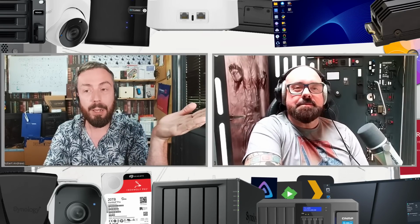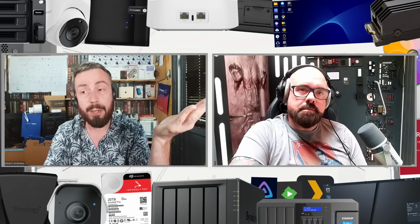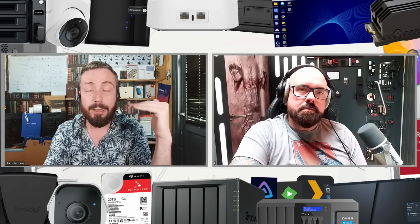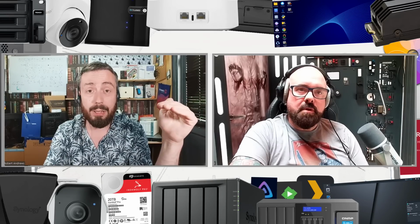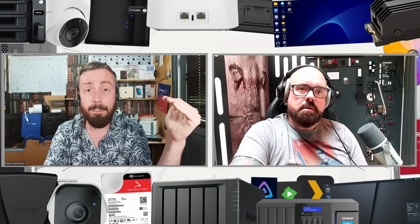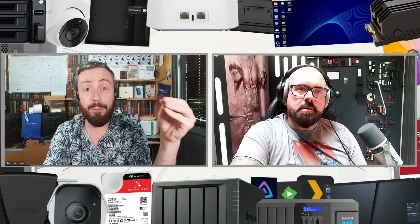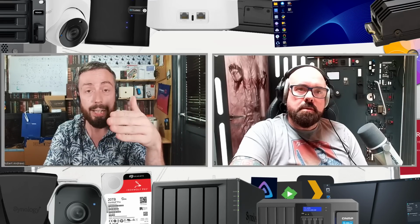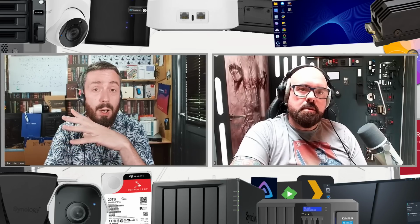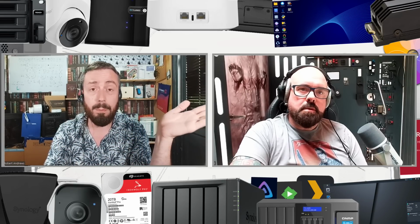For example, if you go for some of the lower tier stuff, say QNAP only has ext4 until you get to NAS devices that retail for about $1,000, because they get to that hardware point within the inclusive software-hardware ecosystem of your purchase, where there's enough hardware to support ZFS, and then you can choose ext4 or ZFS. Rolling back to Synology, they've got support of ext4 or BTRFS. Asustor and TerraMaster both support BTRFS.